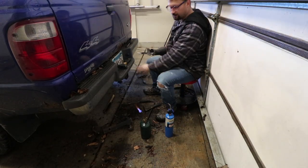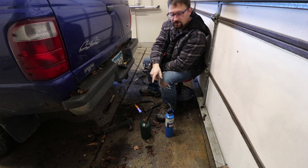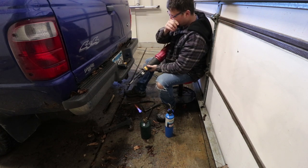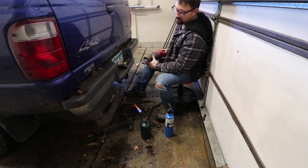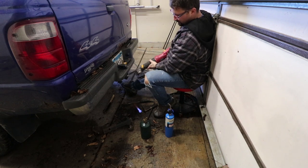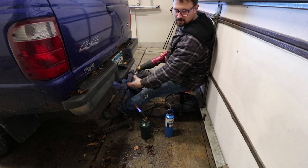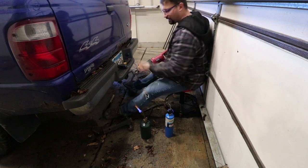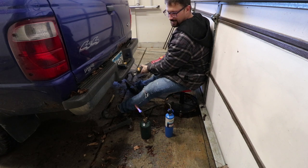We got our hitch out and I'm using the torch — I heat it up in here just to get the moisture out and to descale it, which is the issue. All that rust is just kind of sitting in there. I'm using this sawzall and the end of it will just poke around to kind of scale off that rust. The first half is good — it's just the last half where my screwdrivers can't get the right angle, so this should pick at it pretty good.